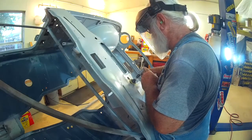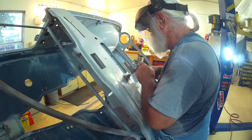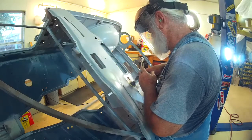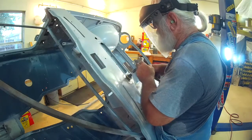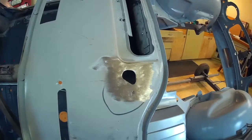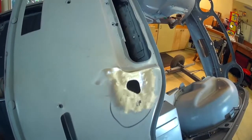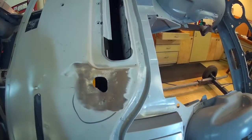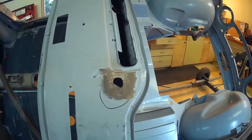Dress it down to a final finish with a 50-grit flap disc and smooth all the edges — it comes out very nice, pretty well metal finished out, shouldn't need any fill. Another repair done. So next edition will hopefully be priming the rest of the vehicle; I've got a couple extra little spots to touch up with the welder, and then the tub will be ready to push to the side. Thanks for watching.